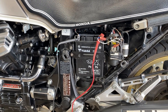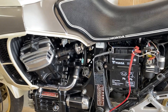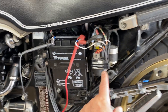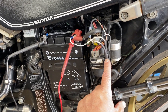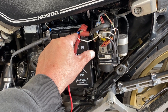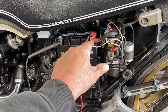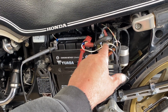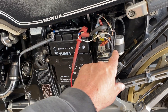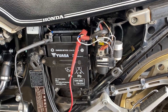This is a video showing the battery and the charging voltage on this CX500 Turbo 1982 model. I added a relay here and now have the regulator output going straight to the battery. The relay gets switched when you turn the key on so that this isn't pulling current and draining the battery when the engine is shut off.